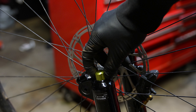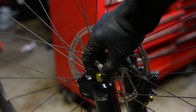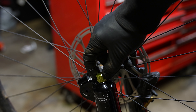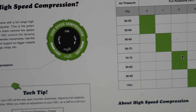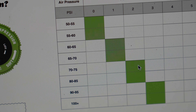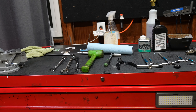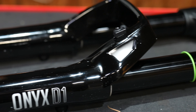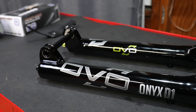One nitpick: you can't feel the clicks when turning the rebound knob clockwise, but when unwinding it does make a solid click. The rebound range is very reasonable — I'm at eight clicks out of 24, so super light and super heavy riders probably won't need a retune, but it is an option and DVO will help with that. The DVO setup guide was pretty accurate — I went up a few PSI and a few clicks faster on rebound, but it gets you very close. It covers both the OTT and SL versions. For full teardown servicing, you only need basic hand tools and a couple of wrenches.